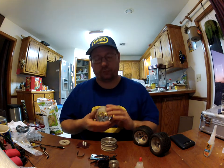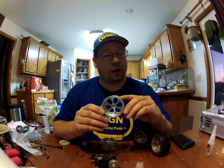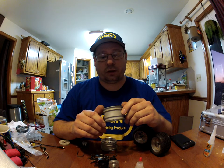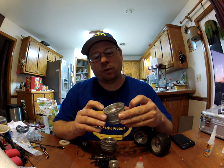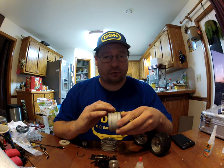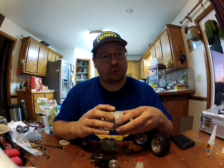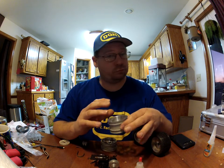First, I'd like to share with you my aluminum wheels. Currently, I only have rear wheels. These I race on our 10-scale nitro and electric sprint cars. One problem I had when I first started making these was being able to get the tire to stick to the wheel. What I found is if you sandblast the bead of the wheel, it gives it a porous enough surface that the glue will adhere and hold your tire quite well.